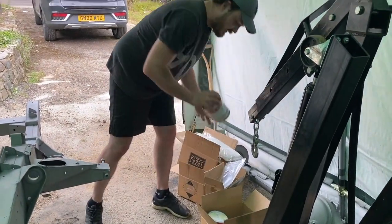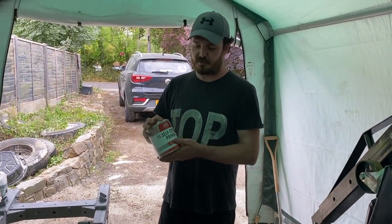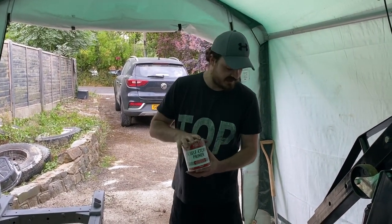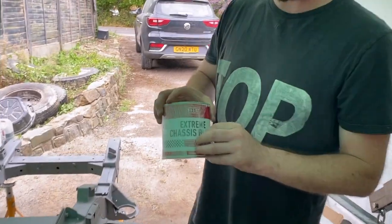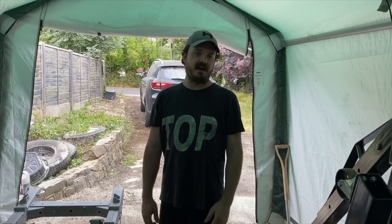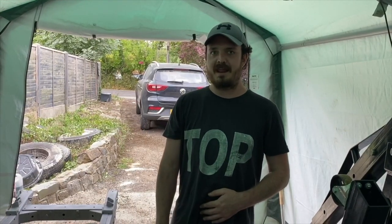And what we are doing on there is we have been in touch with Frost. I can't recommend these guys highly enough. Was on the phone to them. They were really, really helpful, really knowledgeable. They sell a number of different paints, but we've gone for their own brand. So we've got some 1K self-etching primer. We'll lay two coats of that on the outside of the chassis. And then probably in the next video, we've got Frost Extreme Chassis Black. Again, two coats of that all over the chassis. The axles and the components that we've decided to reuse, radius arms, trailing arms, A-frame hopefully, will be getting the exact same treatment. Two coats of primer and then two coats of Extreme Chassis Black.